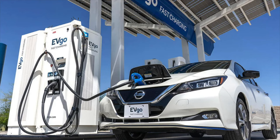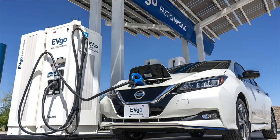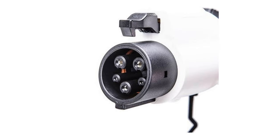DC charging was not a new concept. The Nissan Leaf had already started the DC charging concept with CHAdeMO, though CHAdeMO was limited to 50 kilowatts, making it only fast enough for city fast charging, not really long-distance road tripping. Tesla, on the other hand, introduced their proprietary connector — now referred to as NACS today, because it is now a public standard. This connector had the same fundamentals as J1772, except they changed something with the power pins that J1772 is not capable of.